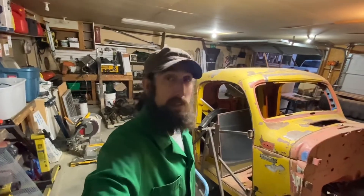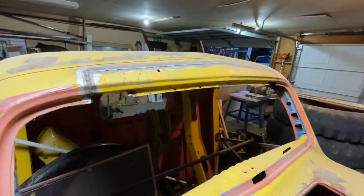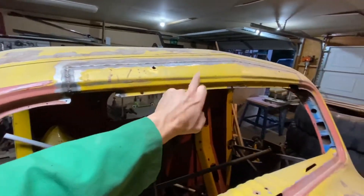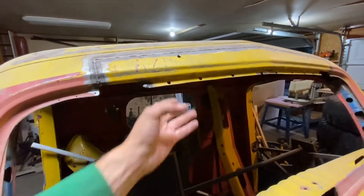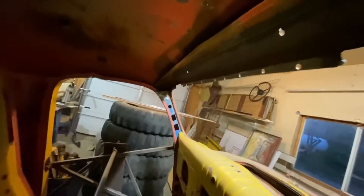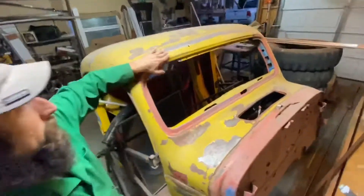So I've accumulated parts as I've been working. Behind me is the cab that I'm restoring. I had stitched in the new part of the headliner piece for the windshield frame because it was so rotted out. The reason they get rotted is there's a headliner piece up there and the mice had gone in and trapped a bunch of wool and debris. That debris got moisture on the headliner and of course it rusted through, so I stitched that in.